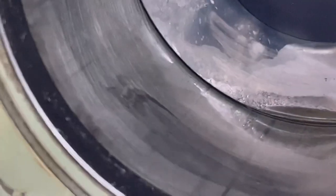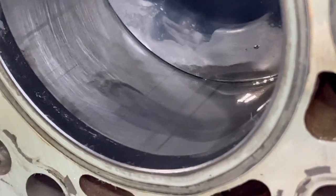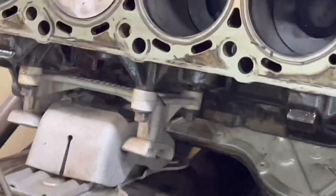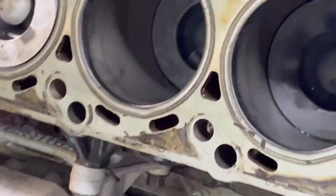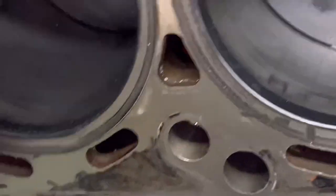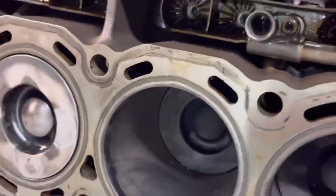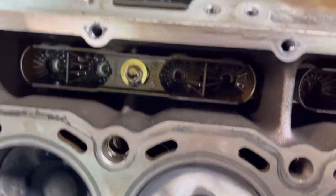I don't know. We could analyze that for the rest of our lives. Why is that there? That'd be another one you'd want to, all the internet ninjas are going to say I screwed everything up, and that spring end gap, that's probably just something introduced in the intake from, well, who knows? I mean, anything on the cylinder wall, the fact that there's so many of them would not be end gap of the ring. It could be anything. It could be quality of air going into it, little air introduced in here, and it gets in between the ring. Could be contaminants from when the engine was built. Which, I mean, I clean the heck out of it, but, I mean, ain't nobody perfect. You know, this has ran for 30,000 miles. So, you know. Let's bar that over so we can see the bottom of this one again. I mean, we could go and replace that lifter.